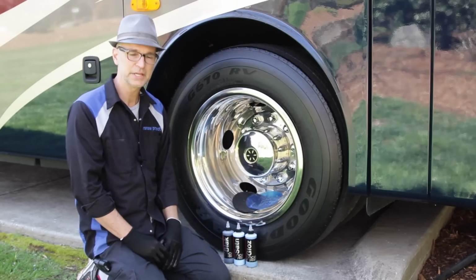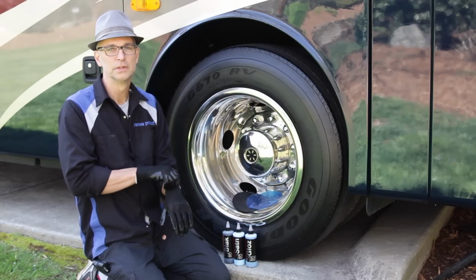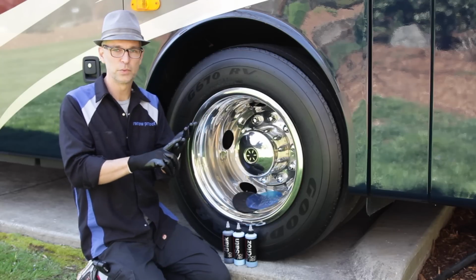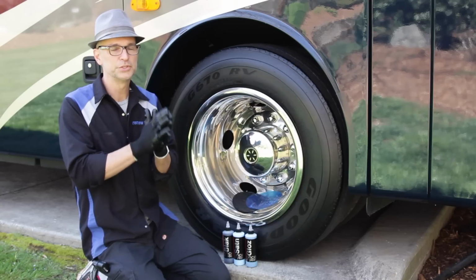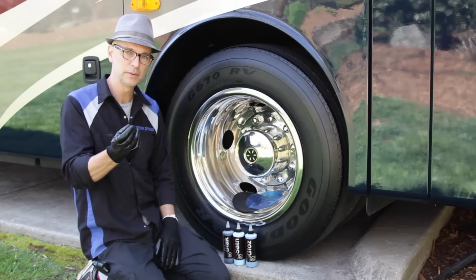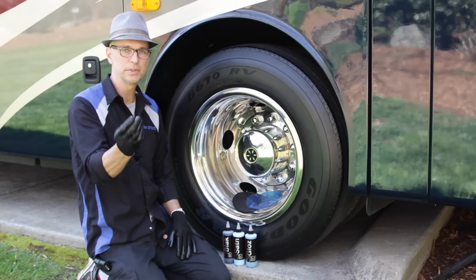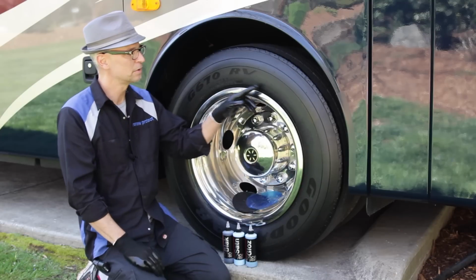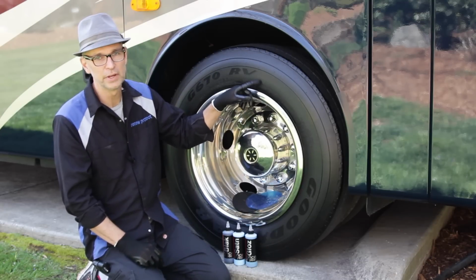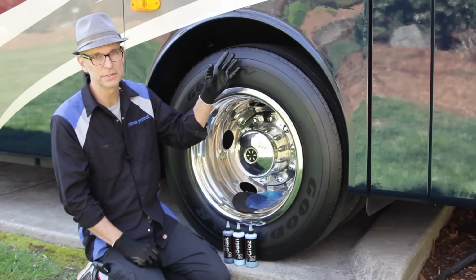And speaking of the protectant aspect of it, I'm really not a big fan. Most protectants out there, of course, are slippery. They're slippery because they're silicone. Silicone is fine. It's pretty harmless, be it water-based, oil-based, doesn't matter. The issue is the emulsifying agents in protectants. If it stays wet and slippery, you give it the test, you do this days later and it's still slippery, that means it's full of solvents. Those solvents are staying active and wet because of the wetting agents and eating away at your tire or your trim work, whatever you're applying these protectants to. So you really want to stay clear of protectants.